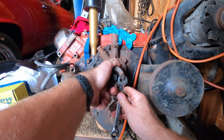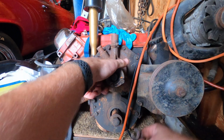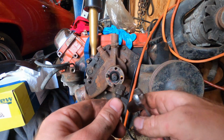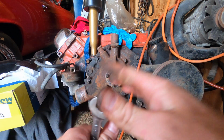She's a coming. So we're gonna get these out, get them in the water pump, get our pulley on, and hopefully a fan or something here too. There you go, there's your stud. So then you just hold these, loosen the nuts off, and clean up them rusty threads and slap them in there. I can't even imagine how dirty my forehead is right now.